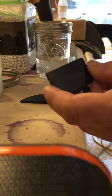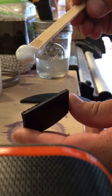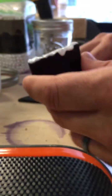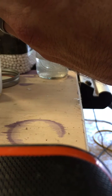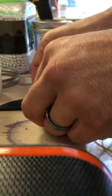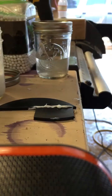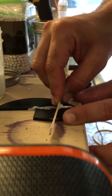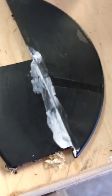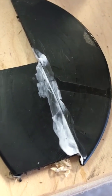Those are just airsoft pellets dissolved in acetone. We're just going to goop a little on there. This stuff dries pretty quickly so you've got to move fast — not super fast, but you don't have 10 or 15 minutes, you've got maybe four or five minutes. I'm going to push them together as best we can and use a popsicle stick to scrape off the excess. You don't have to do this, but I'm doing it so you can see how much we've filled in. If you wanted to make that joint super strong you could cut little butterflies out of that plastic and lay them across it — little stitches going across with that paste.